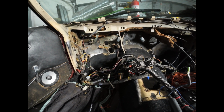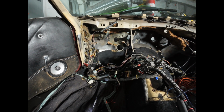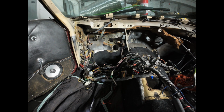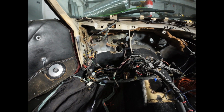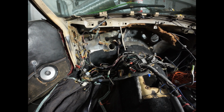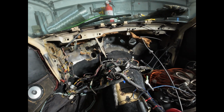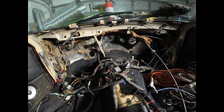But as the wire gets older, it becomes more brittle over time, and that's a natural result of the heat cycling. Every time current flows through a wire, the wire warms up, and then when the current stops, the wire cools down. And over the life cycle of the wire, it embrittles the copper and makes the wiring more prone to breakage. Most of it is stranded wire, but as strands break over time, that means there's less conductor to carry the current, and overall temperature will go up in the remaining strands as strands break away. And so it's not all that uncommon for electrical fires to break out in older cars due to deteriorated wiring. And so I'm going to replace this entire harness.